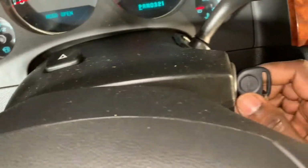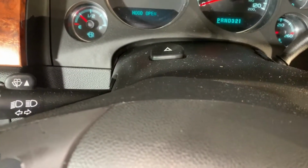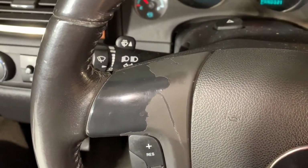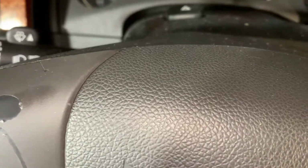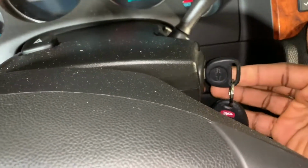But let me back up and say this. Once you remove the gauges and you put the faceplate on, then you want to put the new needles on, because you do get new needles with your face gauge. These new needles, typically they come with them. Not every USSPEEDO gauge has them, but if you're gonna make it look nice, you will get new needles. The position to put the new needles on has to be the 1 position, meaning the first position you turn it to.